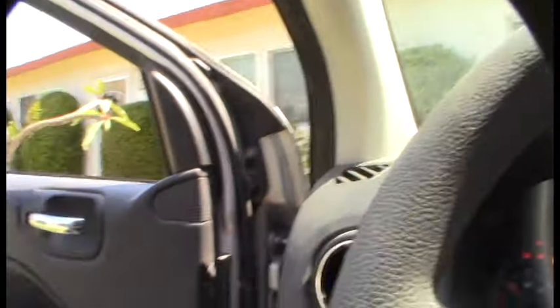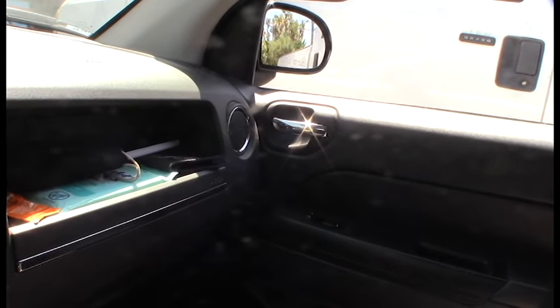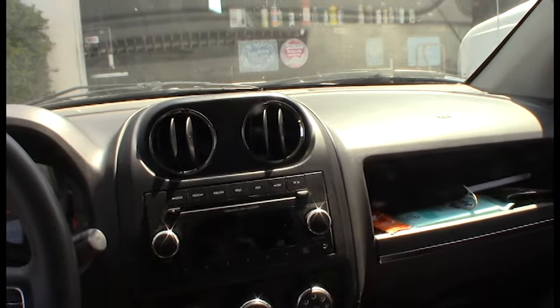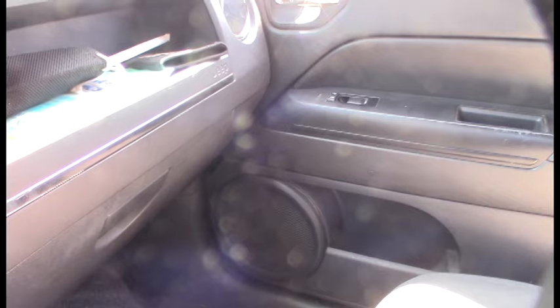Let me show you — I'm going to turn the car on. This one works, you can see the passenger side. I can hear the relay; sounds like it's making noise. I did actually order a motor and regulator kit — it's about 55 bucks at O'Reilly. It's listed as 'front right,' which I guess means front passenger side. Since I can hear the relay clicking, something is moving in the door. I hear it when I go down, but not when I go up.